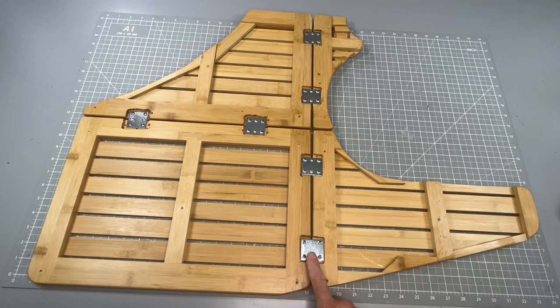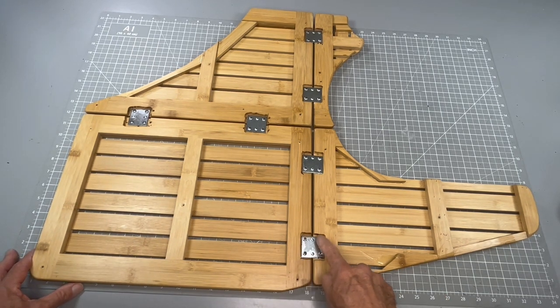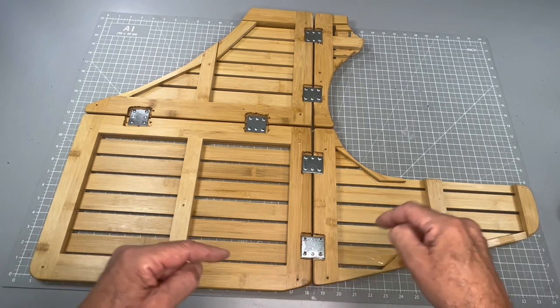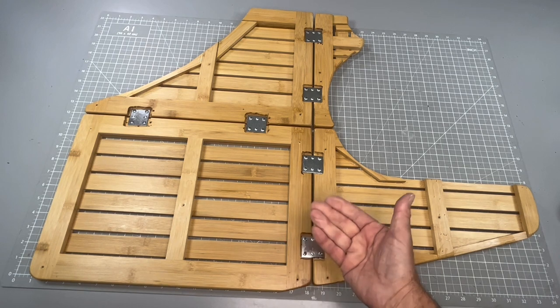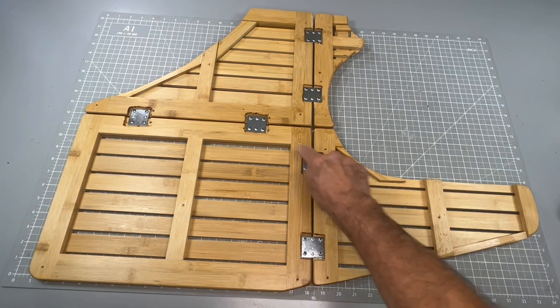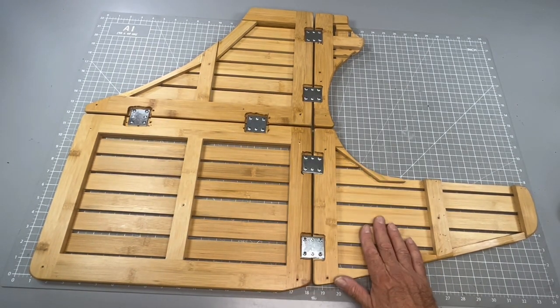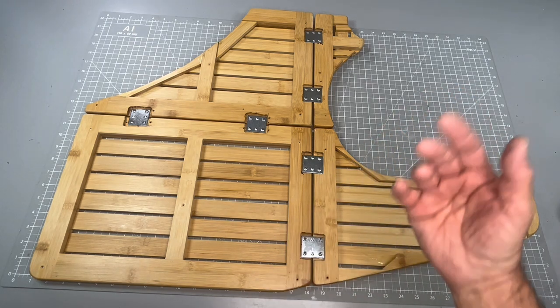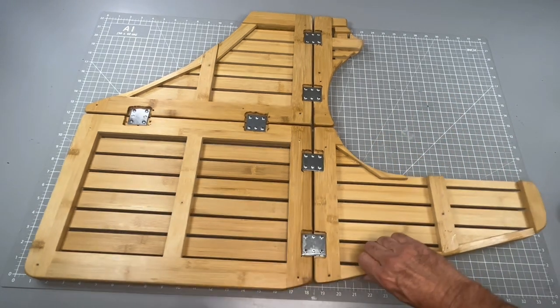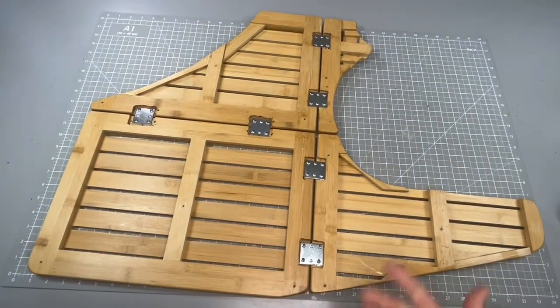These little metal tie plates are from Lowe's — they're reliability mending braces, one and a half by 1.42 inches. I'll put a link in the description. I used half-inch number-six stainless steel screws to screw them down. Because I didn't want to use feet, I used my Dremel tool to route a pocket so that the plates sit below the surface, so everything just sits right down on the floor. The Road Trek floor has a nice molded-in drain channel all the way around the side edge, so draining shouldn't be a problem.